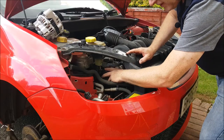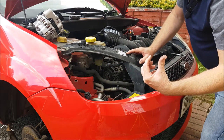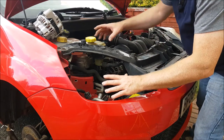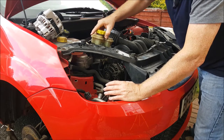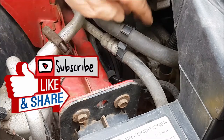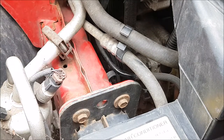To be able to get the old alternator out and the new one in, you need to remove the headlight. We'll show you how to fix the headlight in place when we come to put it back later. Also lift out the power steering pump reservoir from its fixing points — there are no screws holding that in place — and release the power steering feed pipe from this clip on the chassis leg just here. That will enable you to move the pump further out of the way.